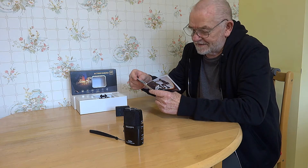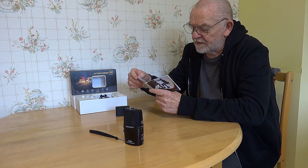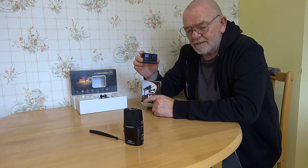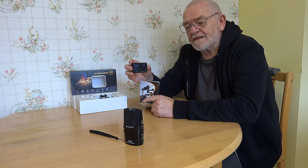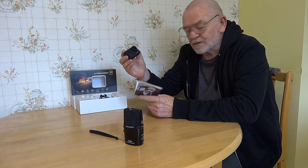The manual starts off: 'Insert micro SD card. Note: please use brand micro SD card formatted before use on a computer. Ordinary or neutral cards cannot be guaranteed to work properly.' Now I put a 64 gigabyte card in and formatted it on the computer — I shouldn't have to do that and wouldn't do it from choice — but I did, and it still came up and said card not working. What you have to do is ignore that, go into the menus, go to the setup menu where it says format, and format it in the camera. That's normal — so ignore the first instruction.